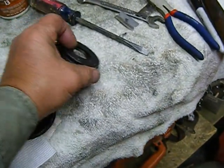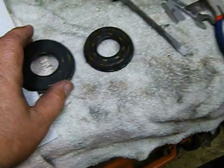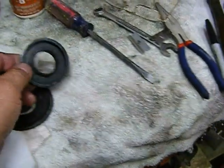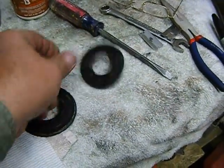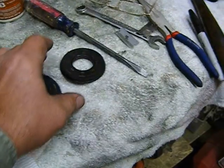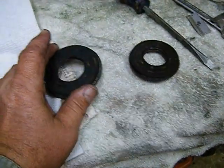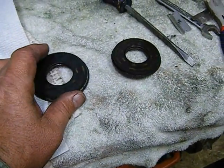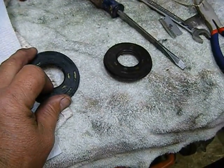Here's the reason why this engine is apart — it's these right here. These are your PTO and mag crankcase seals. A two-stroke engine's crankcase is sealed, of course, and it draws the charge through the carburetor. If there is a leak in the crankcase through these seals, if it sucks air through these seals...